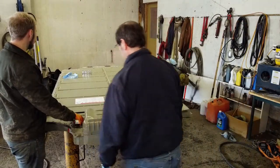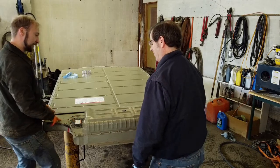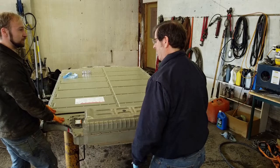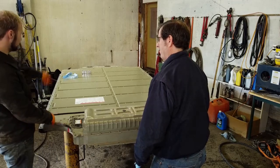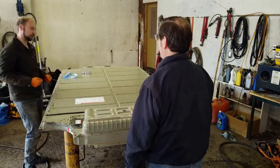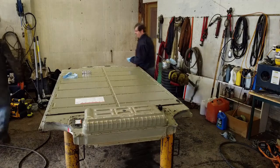At the moment, this pack inside here is 400 volts. So we're going to pull this out, and once we pull that, that essentially splits it in half. So then we have 2 rows of 200 volts. And then we'll take the modules out of the middle. And so we'll pull these 2 first, and then once those are out, we just start pulling modules one at a time.